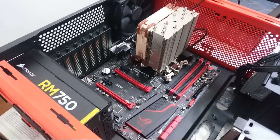I would not have been able to reuse the Cooler Master without disassembling half of the PC and finding a screwdriver with a 90-degree bend to fit under the heatsink. The install with this Noctua was a breeze. I didn't have to remove a single component to do so. It managed to keep the old overheated/unstable i7-3770K under 61 degrees Celsius during the light gaming that I was using it for. I added a second Noctua 120mm fan for push/pull.